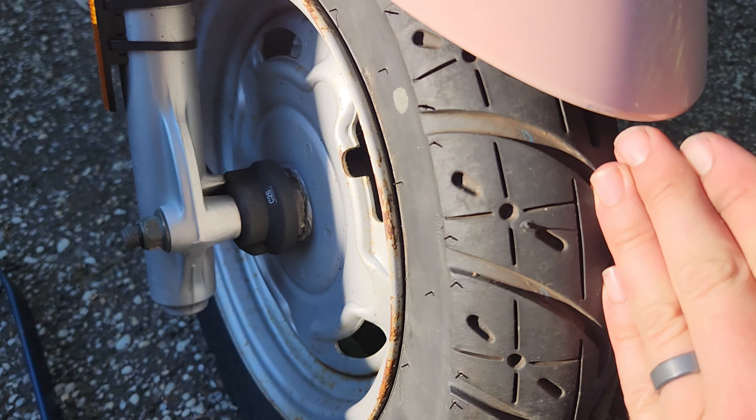Valve stem is back in place. I did get the inside cap off, and you can see once it focuses: one side looks freshly ripped from noon to 6 o'clock, and from noon to 3 to 6 o'clock is kind of chunked up. So it looks like it was on its way to failing, starting to dry up a little bit. My recommendation to you: if you're going to be replacing the tires, go ahead and replace the valve stems. Because when one of your tires fails, that's 50% of your ability to stay upright, steer, and brake — so don't put yourself in that situation.